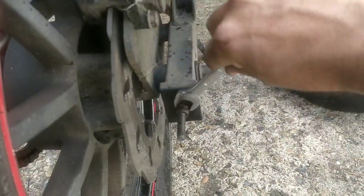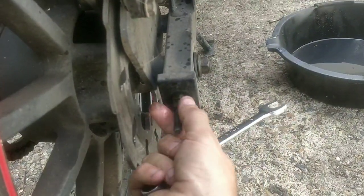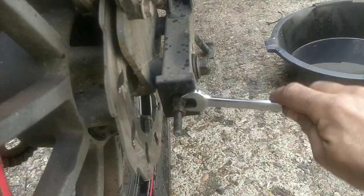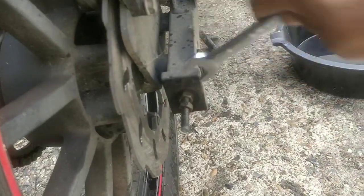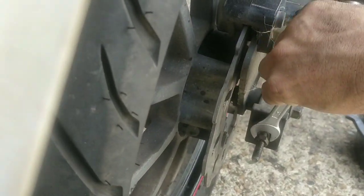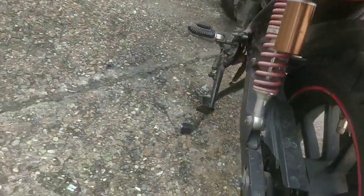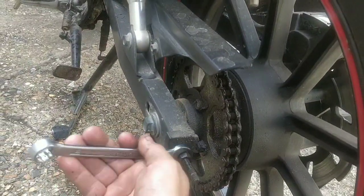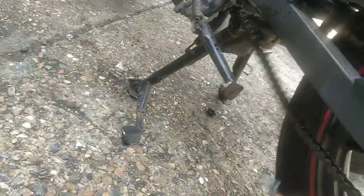So like I said, half a turn on this one, so you go half a turn in. Get this locking nut out the way so it doesn't throw you. Now this is practically upright like that, you see. Half a turn round, make sure it grips. For some reason the 13's not fitting on this right. I'm going to go back to the stop and I'm going to get a 14. Back with a 14, keep it where it is, keep it taut up like that. Half a turn down and around to the bottom, so top to the bottom. If it's slightly off, it's not anyway. So on this side, obviously bottom to the top, you do the opposite, make sure it pinches. And then straight away go to your chain and see what the difference is.